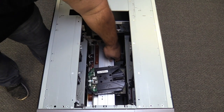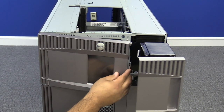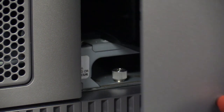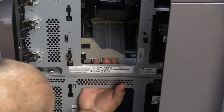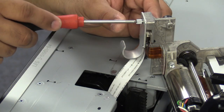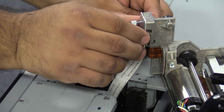You are now ready to remove the picker. The picker removal procedure will depend on the number of expansions below the control unit. If it is only one expansion, you can just reach down inside and pull the picker up gently until it is at the top. If there are two or more expansions, you will need to open the main door on the front of all expansions and the control unit — first slide the IE stations out, using the manual release if locked (a small hole at the bottom of each IE station where you can insert a thin screwdriver). Once the IE stations are all slid out, pull each main door open. Once they are all open, reach inside and guide the picker upwards, feeding it through the expansions until you are able to reach it from the top of the control unit. At this point, remove it from the tracks, being careful not to rip the picker cable that is still attached. Use a Torx size 10 screwdriver to undo the silver screw connecting the picker cable to the picker. Once the screw is undone, carefully remove the picker cable and let it retract back into the control unit, then set the picker to the side.